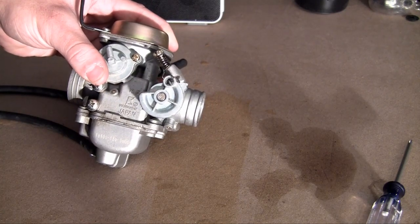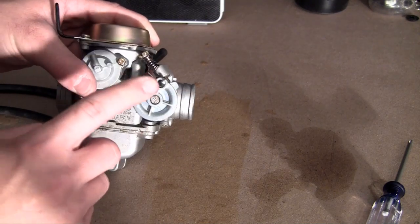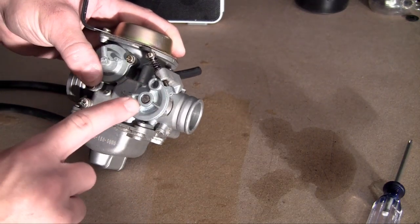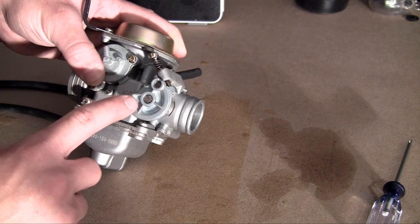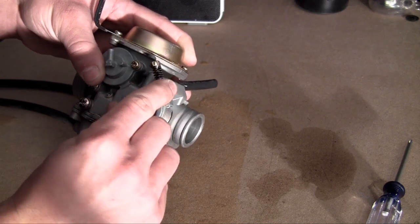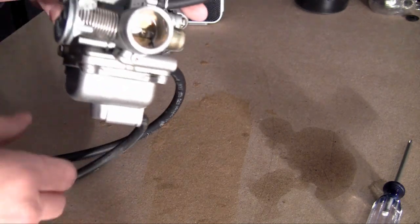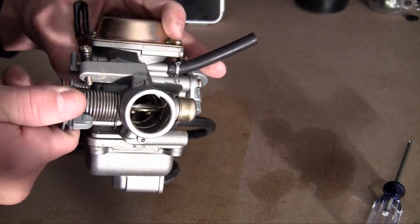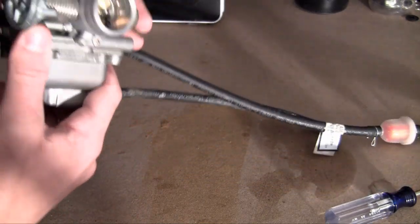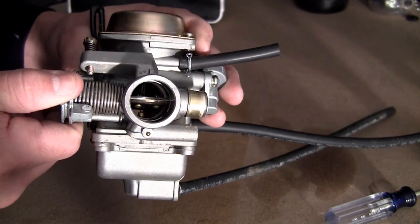The other thing I want to talk about in this video before I actually install this is the throttle — the throttle valve right here. This is going to be hooked up to a throttle cable, and that throttle cable is hooked up to the gas pedal. The more you press on your gas pedal, the more this throttle valve is going to spin. What this throttle valve does is it allows more fuel-air mixture into your engine. It does that by controlling this door right here. All of your air and fuel mixture is going to be inside the chamber in the carburetor, and the more you spin this, the more this door is going to open and allow more of that fuel-air mixture into your engine.